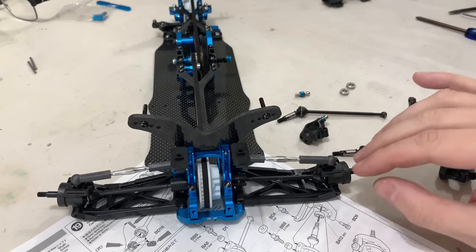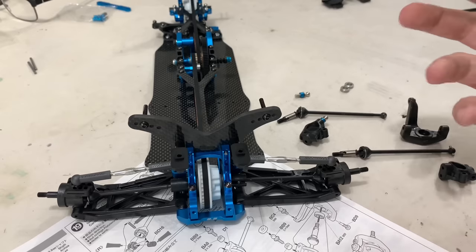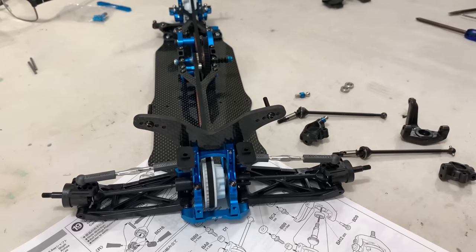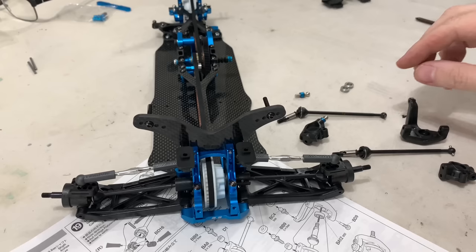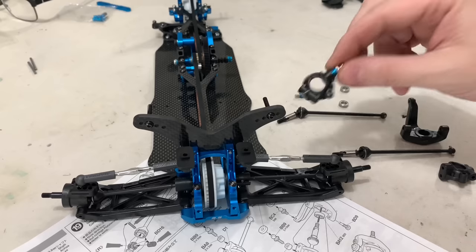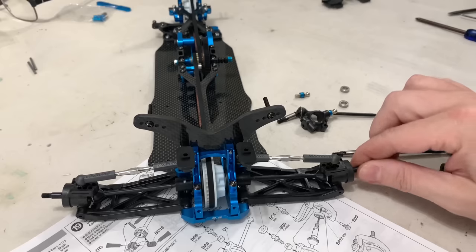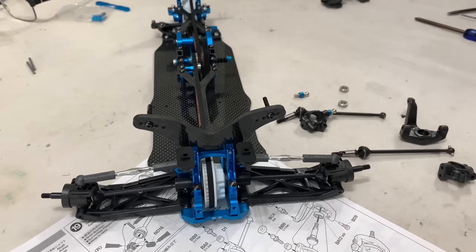I put the wrong two pairs of bearings, and I put the small one in the rears, and that was incorrect, and that's why it was flapping around. I should have picked up on that instantly, but I didn't until I started putting the front bearings in the front hubs. So anyway, I've whizzed the turnbuckles off, took the shafts back out, and I've fitted those bearings, and obviously that's way better now. So I'll continue with the front now.